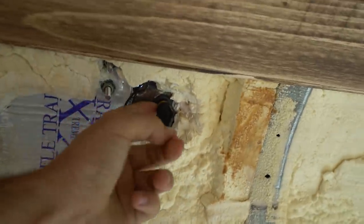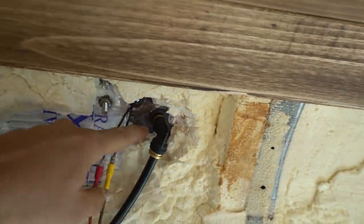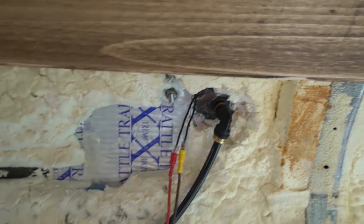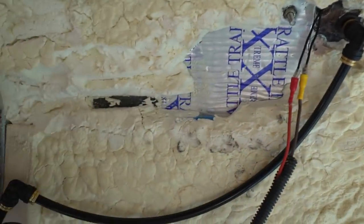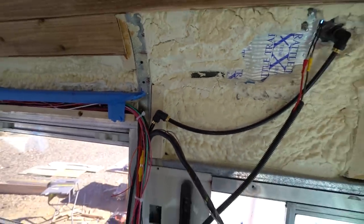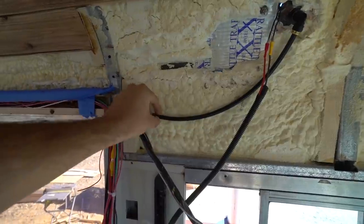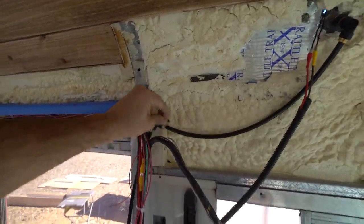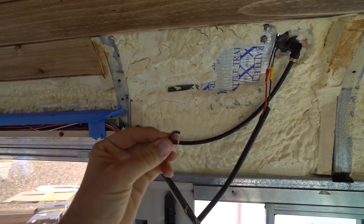I had to lengthen the air hose because the grommet was pushing on the push-to-connect, creating a leak. I'm going to chew out some of this part here and then I have a little clip that's going to hold the air horn right there onto the wood. It's a pretty nice little device.